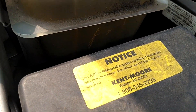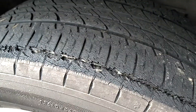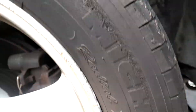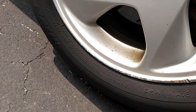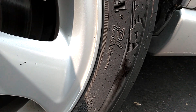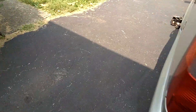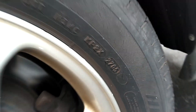Car sat overnight — coolant level dropped. We're going to put it up to the full line, which is that seam on the bottom. Me and Peter are having a little conversation about how many people he's going to kill when these tires blow. This one is from the 15th week of 2002, a radial tire — looks like a Michelin MXV4. Let's see what this other one is. It's the same tire. 27th week of 2005. Look at that one coming apart.